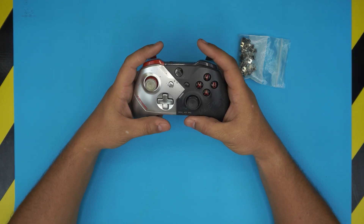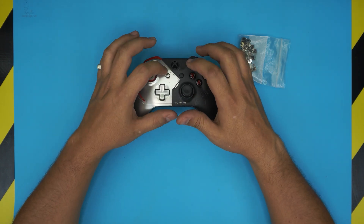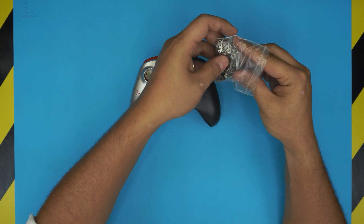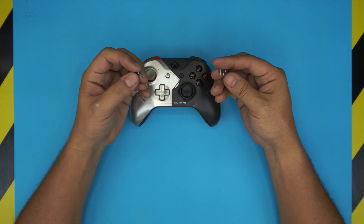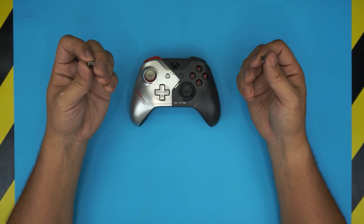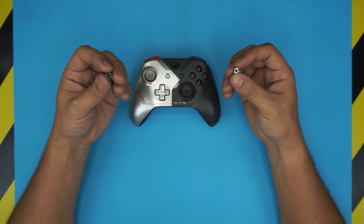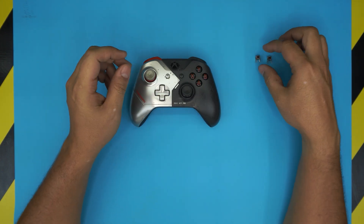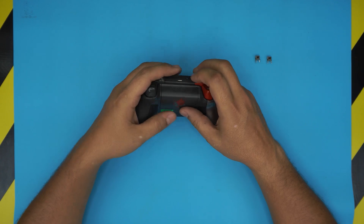What happens is, after a few hundred clicks — or it doesn't matter how much you click, or just the humidity or pressure you put on them — the buttons will go bad. The switches: I'm gonna leave in the description where you can purchase these switches. They have different quality, so switches rated for 1 million clicks or 10,000 clicks — it all depends on your budget. Once you have the buttons purchased, you need to go ahead and open up the controller.